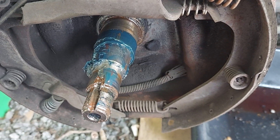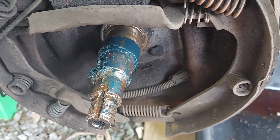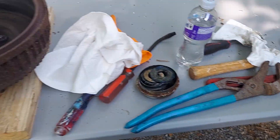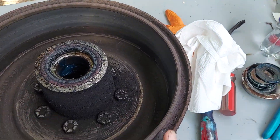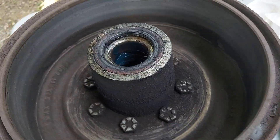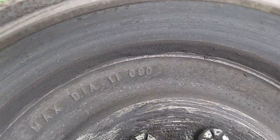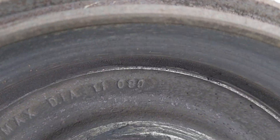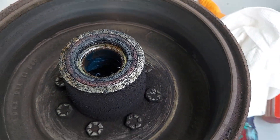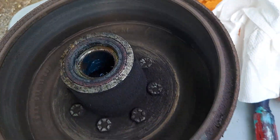The wheel bearings were greased pretty well from when I bought it — they made sure all the bearings were lubed good — but I'm going to repack the bearings because that's what you do when you take them apart. Here's the brake drum, and it's a combination brake drum and hub, so it's got the lug nuts attached to the front of it. I should measure the brake drum to make sure it's not worn out — it's got a diameter of 11.090. They don't really have any grooves in them to speak of, so I think they'll be fine.